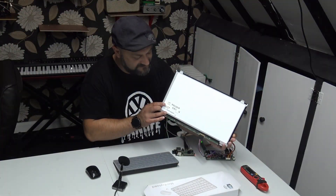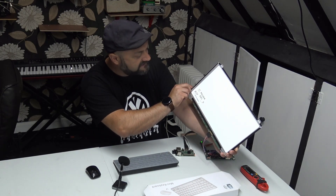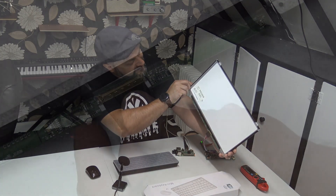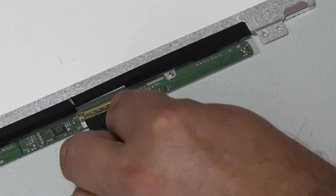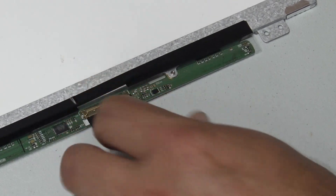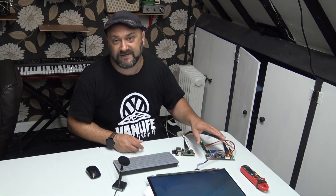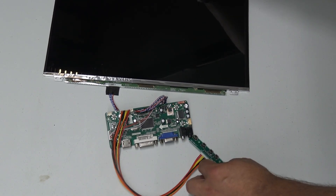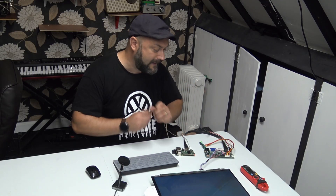The key thing is getting the details of the display once you've removed it from your laptop. This particular one is an LG display made in China — it's an LP156WH3 (TL)(S1), and all of those details are quite important to get correct. In eBay, you literally just search 'LCD display controller' and type the numbers from the back of your LCD display. After about a week, you get something from China that just plugs straight in and drives the LCD — absolutely magnificent.